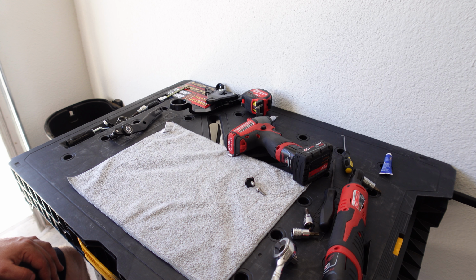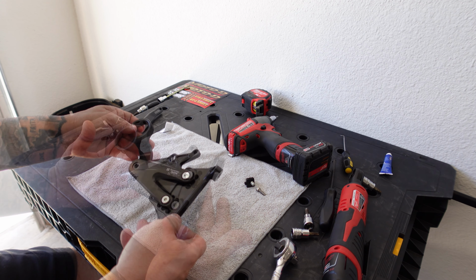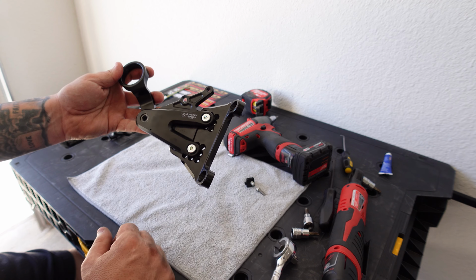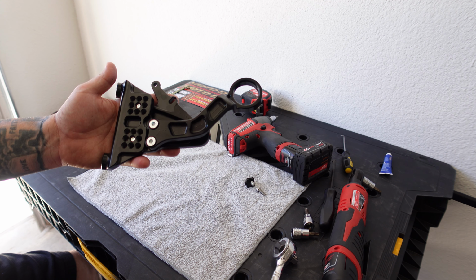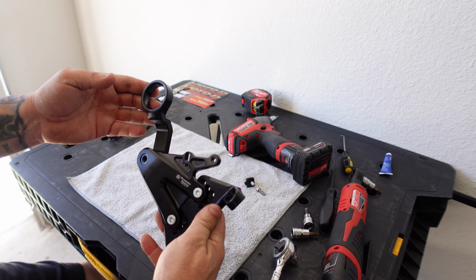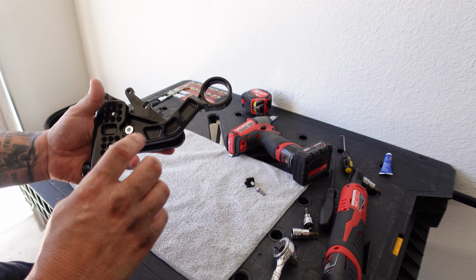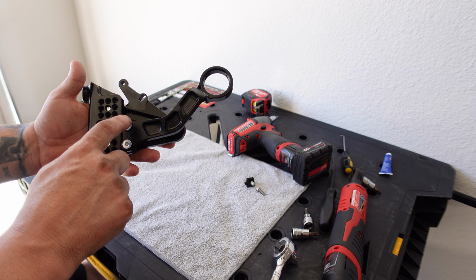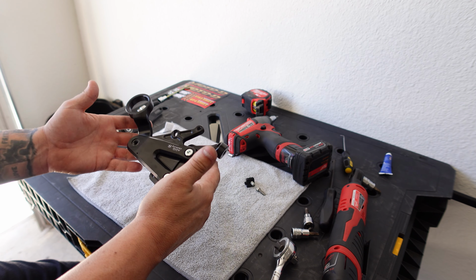All right guys, so part of the joys of filming, you get everything installed and you realize your video wasn't even recording. So I pulled everything on the right-hand side of the bike off to redo it. So I just wanted to go ahead and show you that you take your rear set, and we can install the bracket for the exhaust. Now, if your exhaust doesn't run the factory location bracket, then you don't have to put this on. But mine does. So go ahead and install it and torque it down. Everything is 25 Newton meters as before. So that'll get you to that point.